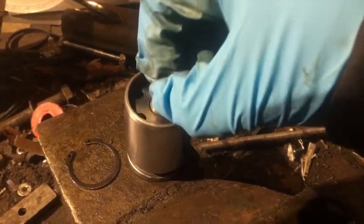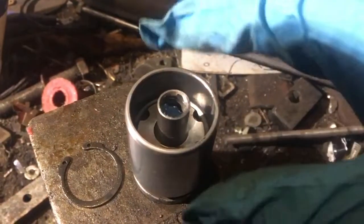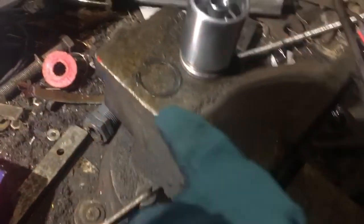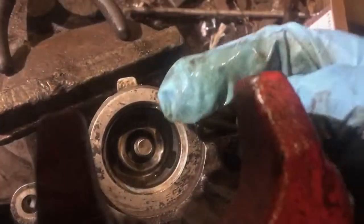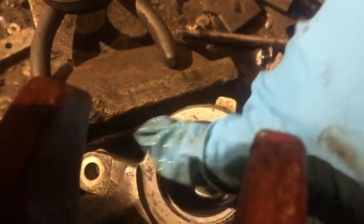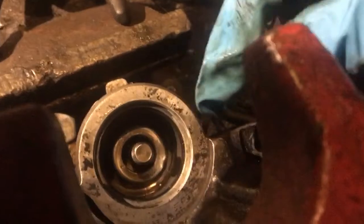Just a tiny bit of grease at the bottom. All the little plates are cleaned and installed, and a tiny bit of grease just at the top where it rotates, pushed home. Now we get the O-ring or spring clip and put it in. Next we get the first seal and install it in the furthest gap back. We take a wet finger of brake fluid and run it around, soaking everything in a little bit of brake fluid as lubricant to help it all move. The seal is now well lubricated.